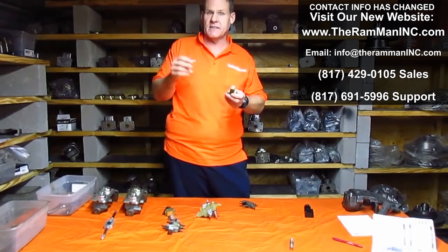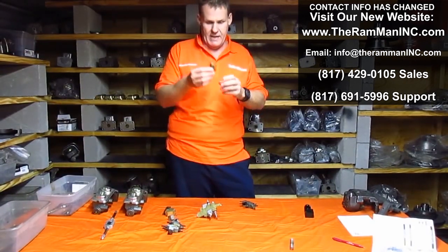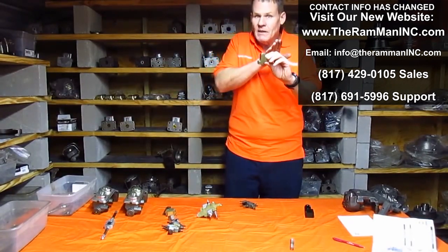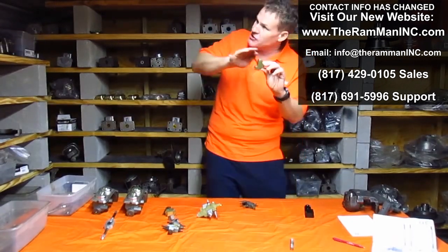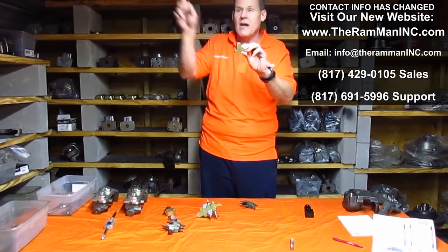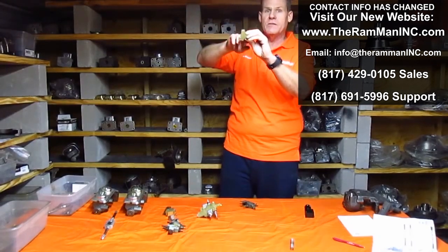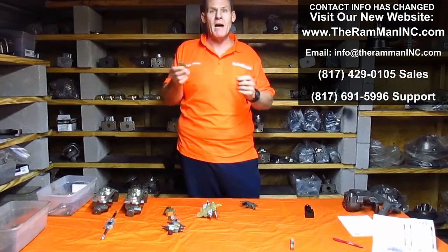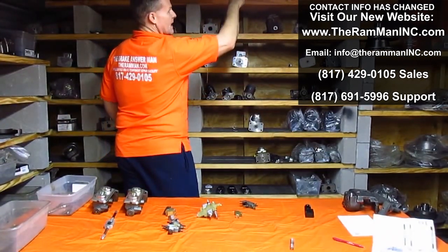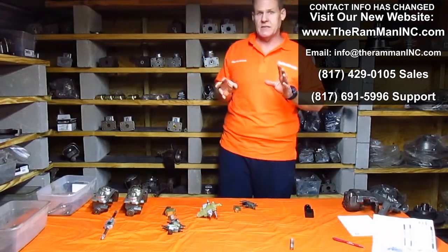A-body, B-body, and such — normally 250, 275, and on station wagons about 300 PSI was the cut-in pressure. Now let me remind you: these valves under light and normal braking don't do anything. If the line pressure doesn't reach 275, they just let it cruise on through. They are a completely flow-through valve with no restriction whatsoever until they reach that cut-in pressure. This was designed for emergency braking. When that pressure level raises real high and overloads the spring, it cuts that line pressure from then on about 50%. That's why on a graph it's linear up to your cut-in pressure and then it slopes off gradually.